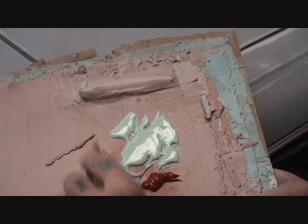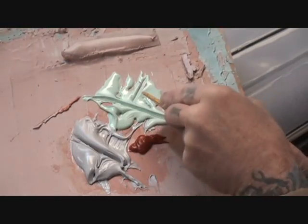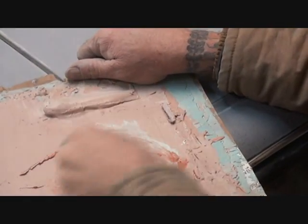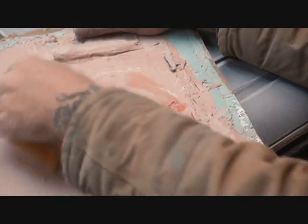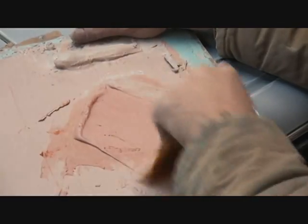What I do is I take Bondo, I take Evercoat, and I take my hardener. Now what that Evercoat's gonna do, if you watch real close here, let me mix it up. And if you watch close how I'm mixing that up, it's like kneading dough. See there? Just like that. Until there's no streaks in it. It's one solid color. I have put a little extra hardener in here because of the weather. Due to the very cold temperatures we're having right now, I have to add a little bit of extra hardener. You don't want to add a lot because then it will never dry, and if you don't add enough, it won't dry. It's just a case of practice makes perfect on Bondo. So I get my Bondo mixed up.